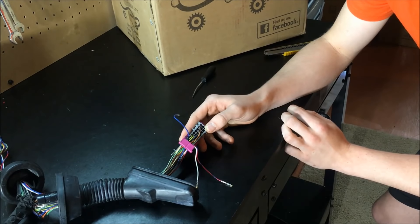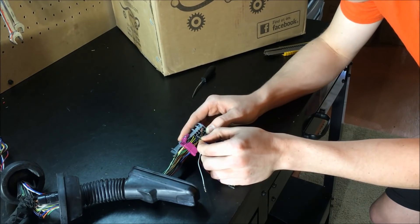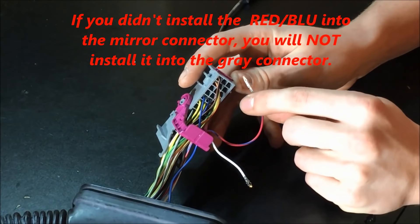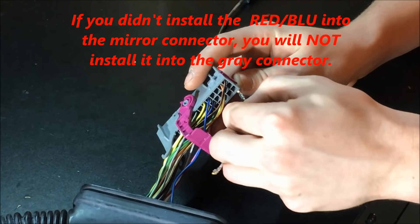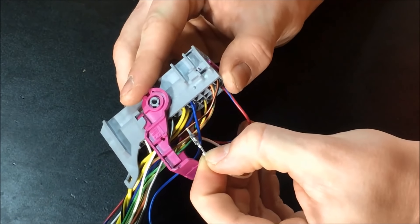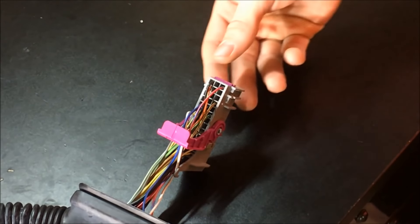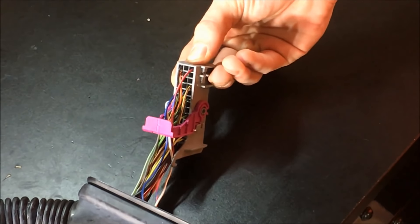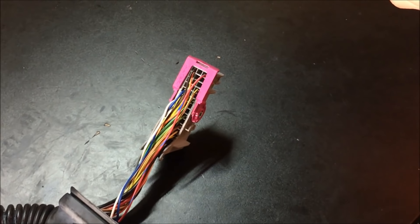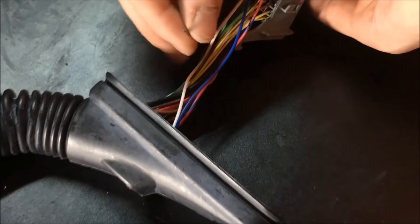Take the blue wire and put it into pin 11 on the gray connector. All pin locations are numbered on the front and back — be careful not to put them in the wrong location. Take the red and blue wire and go to pin 41. Take the white wire and go to pin 9. You don't need to lock the connector for that — just go to the other side, push down with your finger on the tab, and slide it back down. Install the new zip tie onto the gray connector, going through the two divots and looping all the wires through.